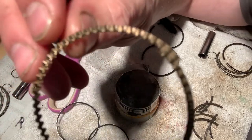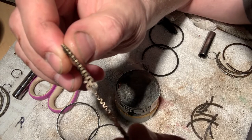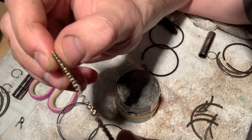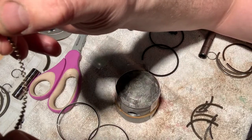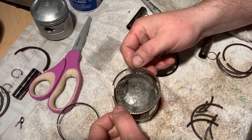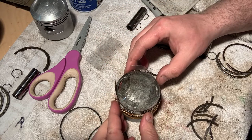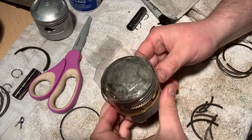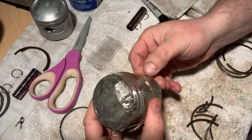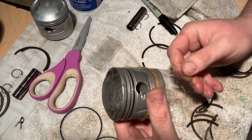When you install it, you're going to want this thing to actually butt up against it - it should sit there like that. It shouldn't be overlapping. I got to give a hat tip to Saturday's Wrench here too, because he did an amazing job filming a top end engine rebuild and I picked up a ton of information from that. This goes in our bottom slot. I'm just going to gently get this around each piece of my plastic here, slide her down. It's working really well on this oil ring - that's a good test.